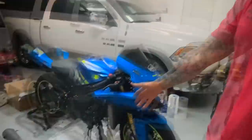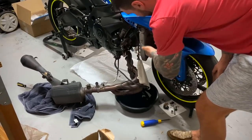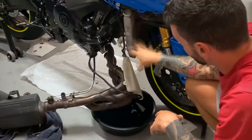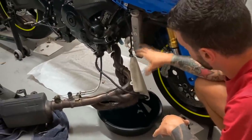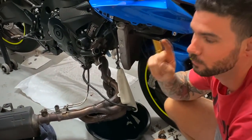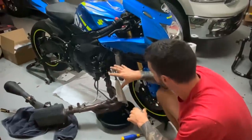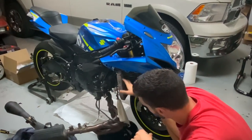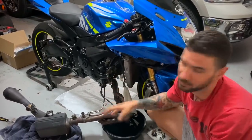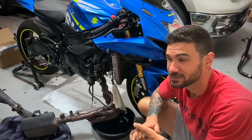So on this bike you have to take apart — take the headers off, the exhaust off, you have to hinge the radiator, basically disconnect it and hinge it forward so you can get to the headers, then take the headers off. So: drain the coolant, hinge the radiator forward, drop the headers and exhaust out of the way. On these bikes, unfortunately, you can't drop the oil pan without moving the exhaust, which calls for all of this work. When it should have been like an hour job, now it's like a four-hour job — but saving myself like 700 bucks, which is what the local dealership quoted me.